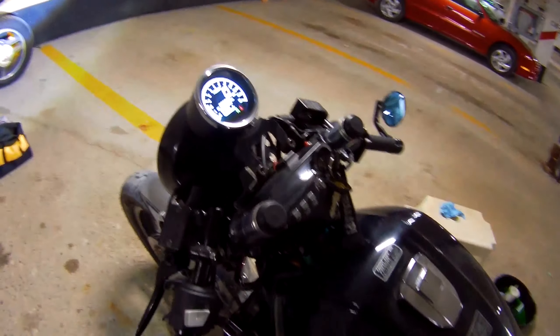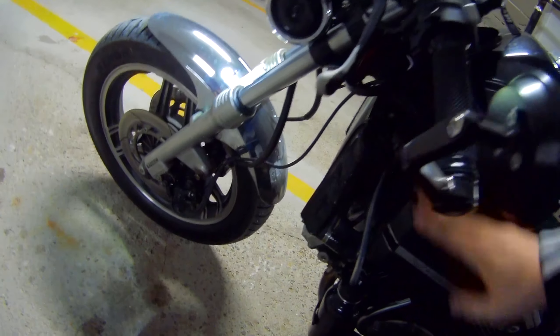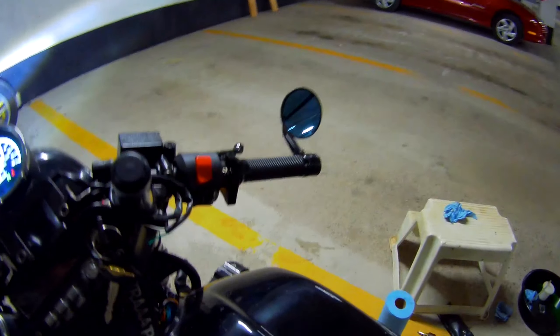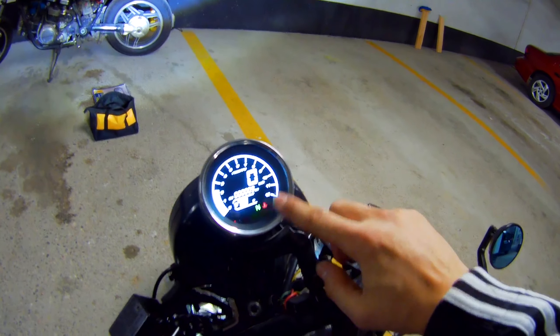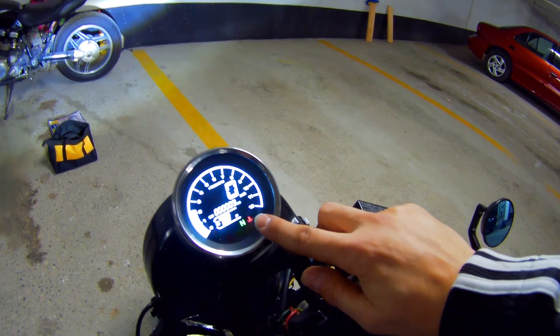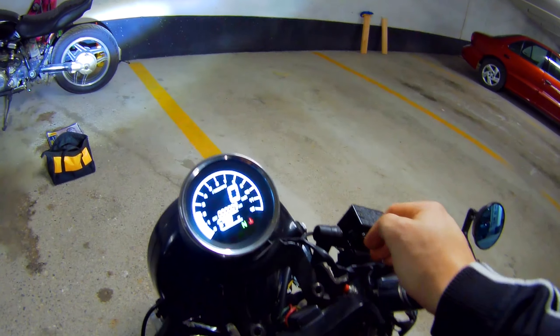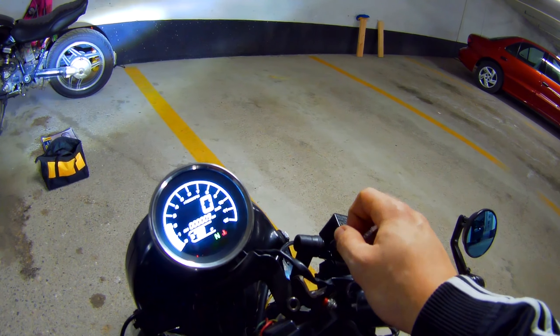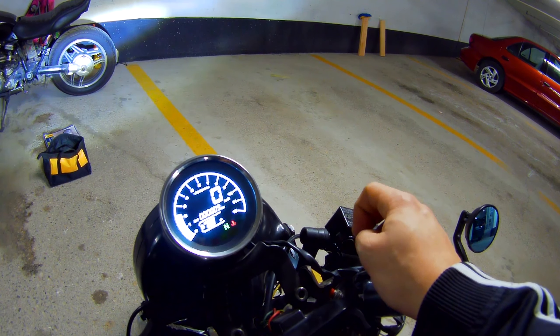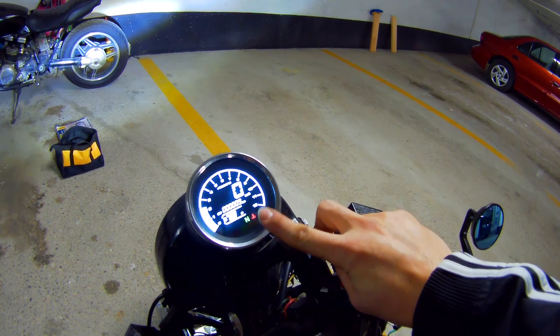The coolant system is filled and it's cooling, but the light is still on. I realize that light is triggered by any resistance below 160 ohms. Right now the bike's wiring and temperature sensor indicate anything above 60 Celsius is 140 ohms or lower, and when the bike gets really hot it's almost 4 ohms — almost no resistance. So really what this light is telling me is that the bike is up to operating temperature.